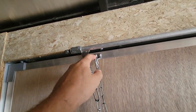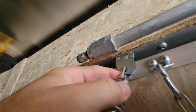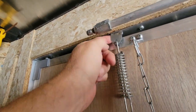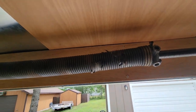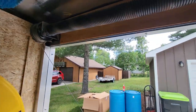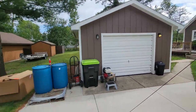Make sure these aren't broken. A lot of times the wind will buffet these. See how that one's bent in right there — see how hard that's bent right against my door? It's actually rubbing on my door. That is from pulling. I'm bending it back now. That was because this door swung from the wind and bent that bracket back. Things you want to check and make sure nothing's snapped out and busted off. Don't get carried away with these — they're very dangerous. You should have good equal tension on both cables and make sure they're working right.